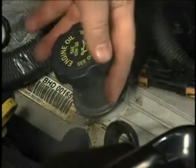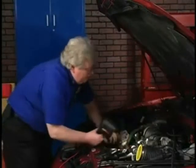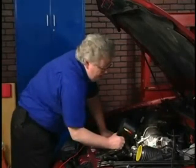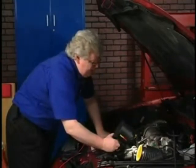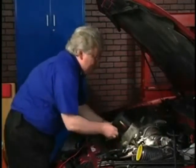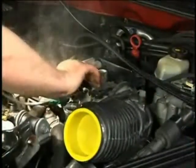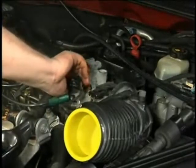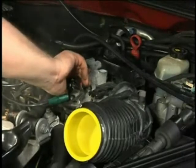If we take a look underneath that — oh no wonder. This car needs some work. We need a new valve cover and we need a new vacuum fitting for these two hoses off the side of the throttle body. So let's go ahead and fix this and see if she smokes anywhere else. Before we send somebody off to get the parts, I'm just going to pop that jury-rigged hose fitting off, put my thumb over it as a temporary fix, and see if it leaks anywhere else. It's just making the smoke go out the oil filler neck all the more from that broken valve cover.